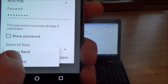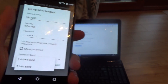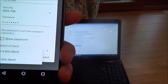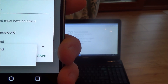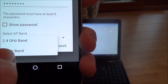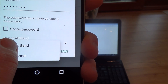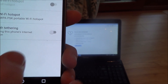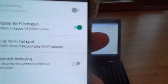If you're connecting to a range of different devices, leave it on 2.4 GHz because a lot of older equipment won't be compatible with 5 GHz. But if you're only connecting to newer devices like Xbox One S or PlayStation 4, those are 5 GHz enabled so you could use 5 GHz — it's a less busy channel and you may get better speed. Because I'm connecting to numerous devices I'll leave it on 2.4 GHz and save.